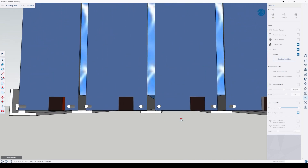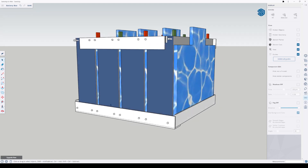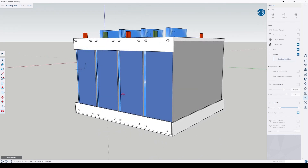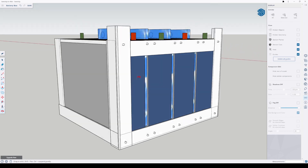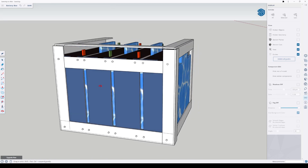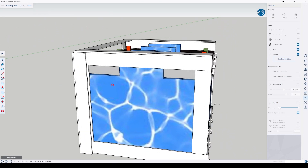These plates are 1/8-inch mild steel, but the rest of the pack uses 3/16-inch steel. Most of the construction is using 2-inch by 2-inch angle and 2-inch flat bar. Then, on the front and back side of the pack, I will have mounting plates with 6mm holes that line up with the 6mm threaded rods coming through each module. Each one will be held in place with a nut, which prevents the modules from moving around. Uprights are then added to hold the structure together. A top is added that clears the cooling plates and creates a space for bus bars, BMS wiring, and coolant distribution.